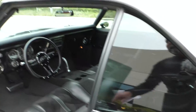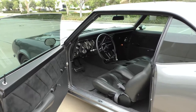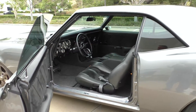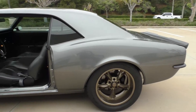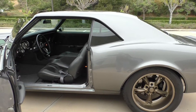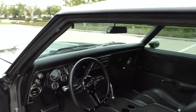If you're looking for a car you can drive and have fun with — maybe even do an autocross event — you could do it with this car. On the suspension side, it has Detroit Speed Engineering suspension underneath: tubular control arms front and rear, four-bar suspension in the rear. We'll get it up on the lift and cover it in more detail. Up front, a DSE 600 power steering box, hydro boost, and four-wheel disc brakes.